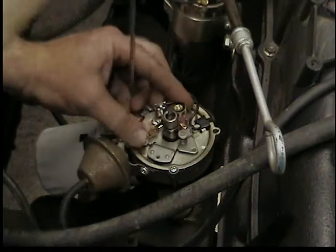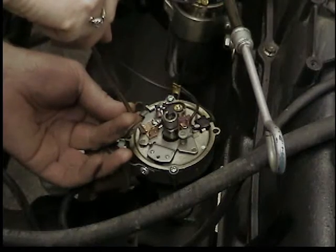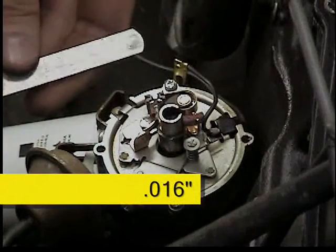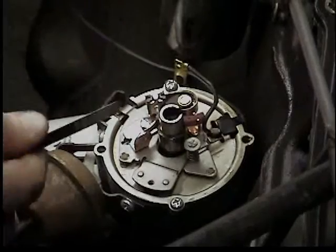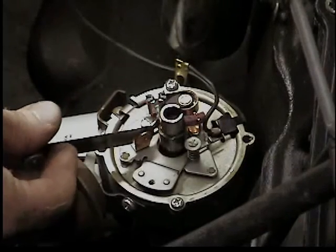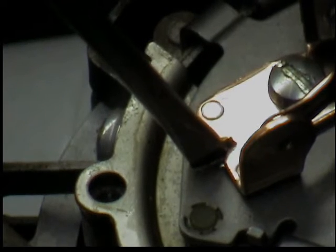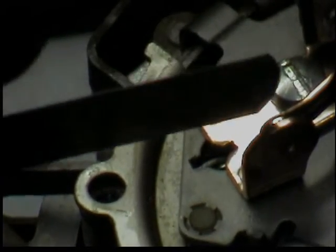Still want a little bit of tension there, not completely tight. Then we can use a screwdriver in this slot to adjust the points in and out. We have to have the motor turned to where the rub block of the points is riding on one of the cam lobes. Put a wrench on the bolt that holds the harmonic balancer and turn the motor until the points are opened all the way. The recommended point gap is 16 thou — use a feeler gauge and stick a screwdriver in that slot, twisting one way or another to give it more or less gap or dwell.